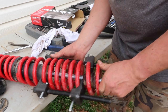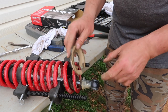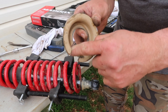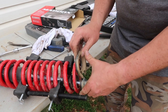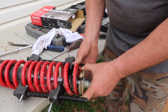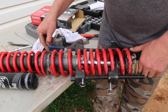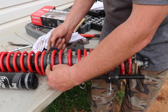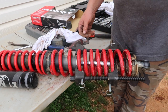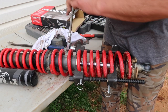Might be able to get this. Here's my retaining clip — it just goes through the slot here, the shock shaft goes through the slot, and the spring when I undo the spring compressor is going to fall right back on it. I want to make sure that the two spring ends — from the top spring and the bottom spring — are 180 degrees out, meaning one on each side. Let's release some tension.